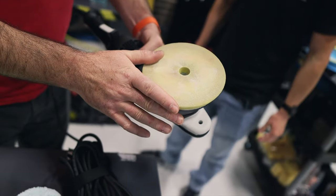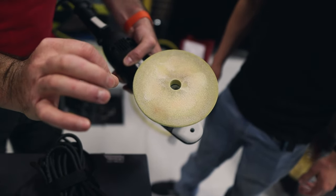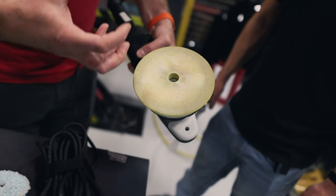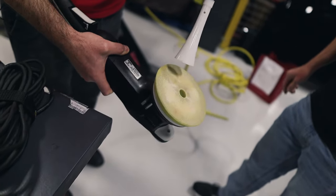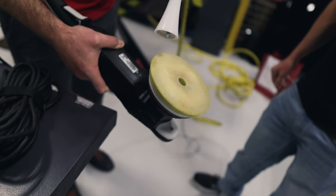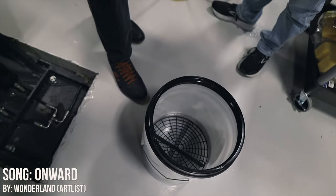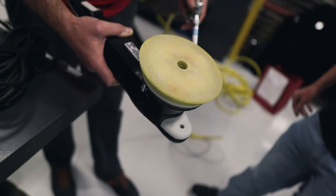Let's clean up some of these pads — some freshly used, some that look like they've been sitting with little burn marks in them. Start with the on-the-fly type of cleaning. Here's an example of a pad just used on a panel — we have residue from clear coat and from whatever polish was used. To quickly clean it out, it's not going to be perfectly clean, but cleaning on the fly just clears out the cells so you can put fresh product and go back to work. We're going to take the Tornador gun and very quickly blast it clean. You can do it while spinning, but that creates dust, so a tip is to put the pad in a bucket with a little bit of water and blow it out — the dust will collect in the bucket. You can also just use a regular air compressor gun.